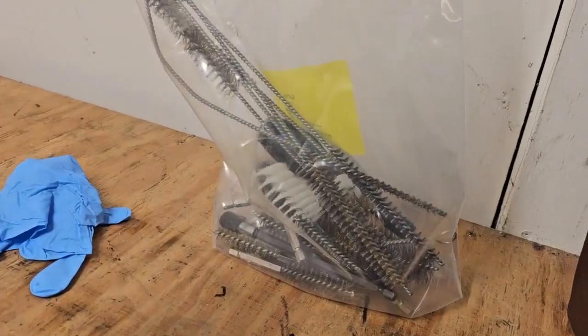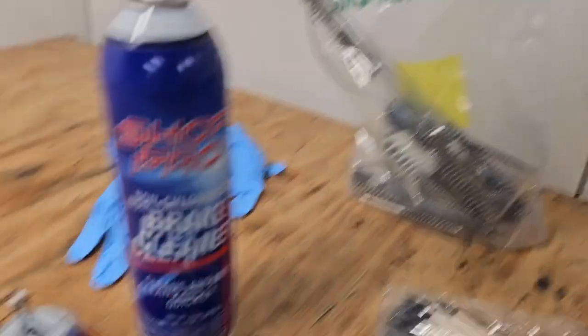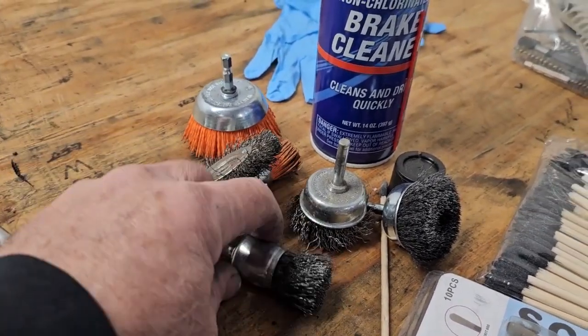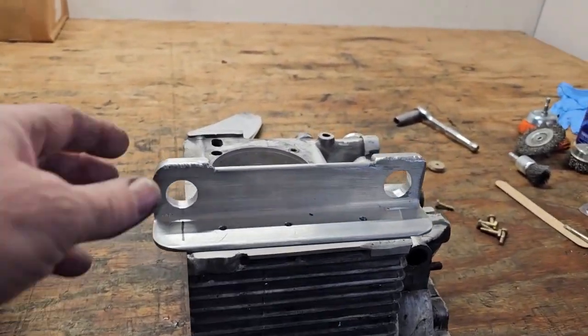This is cold and nasty here in Missouri. I've been cleaning the engine cases and I think I finally got them to where they're good enough to go. Took them to a car wash, got all the oil passages blasted out, bought a bunch of assorted cleaning brushes from Harbor Freight which worked really well for the oil passages, and then wire brushes of various sizes for the external parts. This one was very handy for getting into all the nooks and crannies.